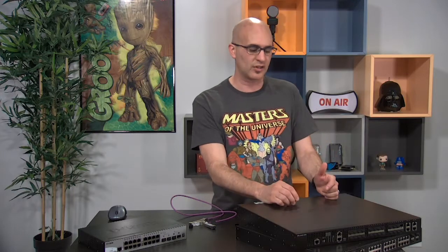When you're picking a switch, you want to ensure that each port has enough available bandwidth for 10 gig up and 10 gig back, because these transceivers are bi-directional. Get into the manual and determine how much bandwidth every port has on the switch. Second, check how much bandwidth the backplane has — meaning total throughput through the switch. Especially for AV over IP, you don't want buffer overruns or packet losses because you chose a cheap switch that didn't have enough throughput.